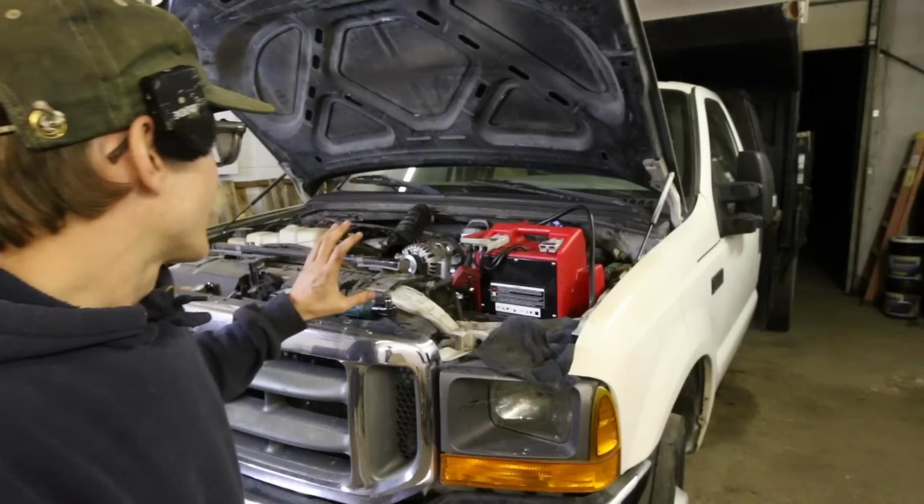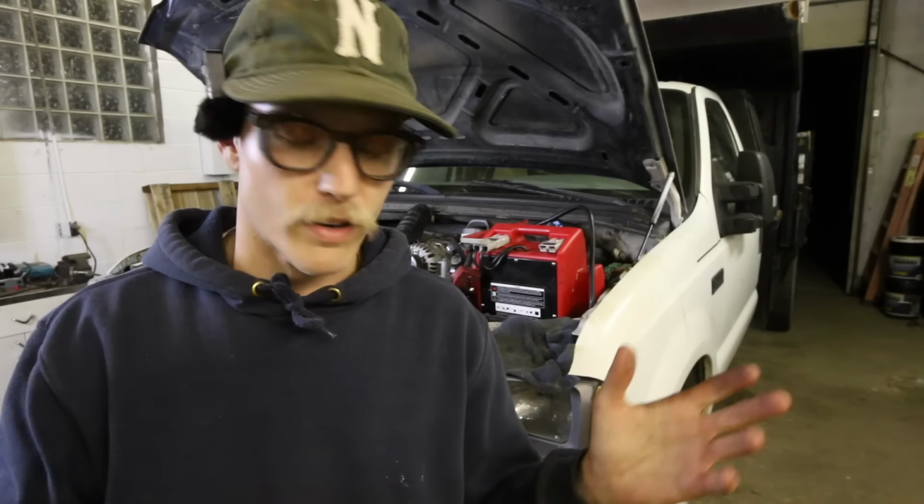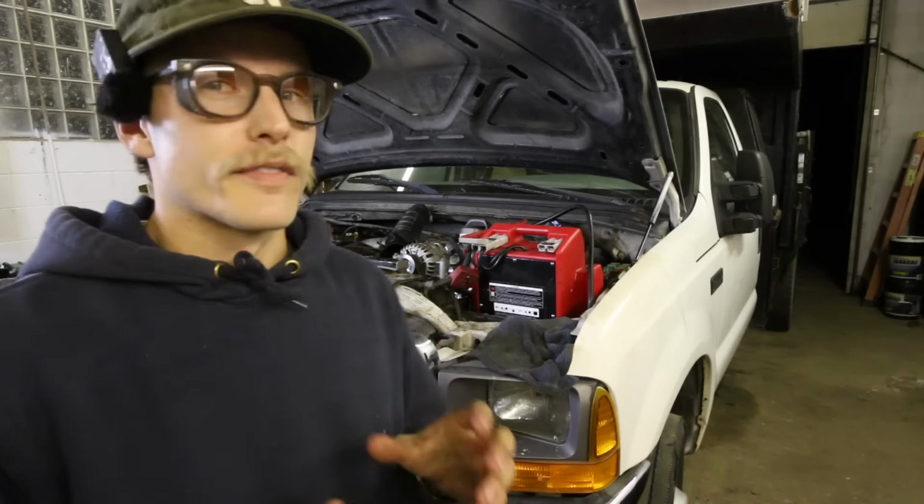Sure. I have the valve cover gasket hooked back in. Everything's all plugged back in and set, but I still have the valve cover itself off, as well as my piping and all that, just to see if this thing is going to run, and if it does, if I'm getting life out of those two injectors that I put in. After we verify that there is, then we can button it back together, but I'm not necessarily sold on anything yet, so we're just going to test it this way first.